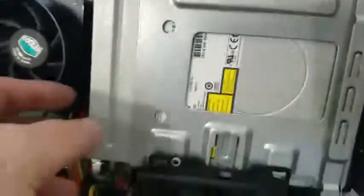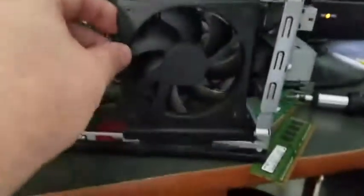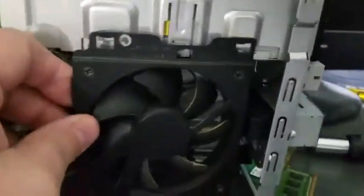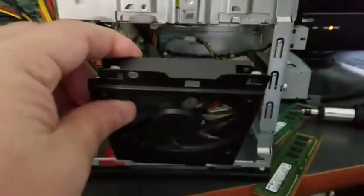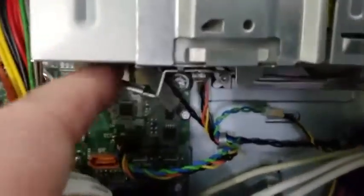Once you've done that, you can slide out the CD-ROM out of the chassis. First, you need to pull off the fan — that's real simple, it just pulls back and pops out of the slot, then pulls up. Just snaps right in and out.